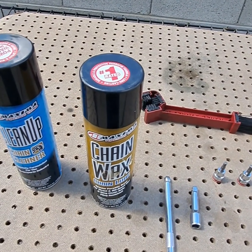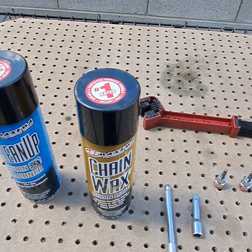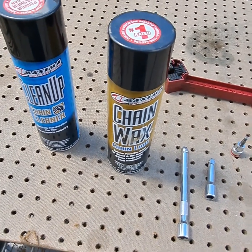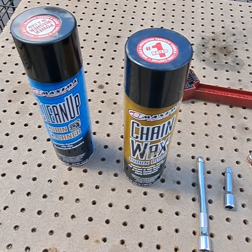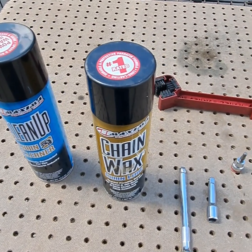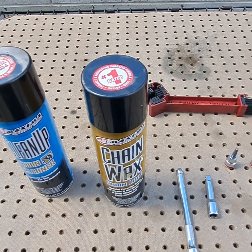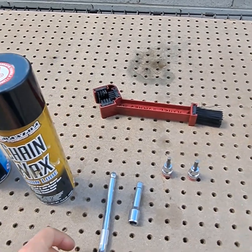You've got to be careful with those O-rings because if those deteriorate or wear out, you're going to have problems with your chain. And definitely when you clean your bike, do not power wash the chain. I know it's tempting — it'd be real easy to clean it that way, but you're going to damage those rubber O-rings on those chains.